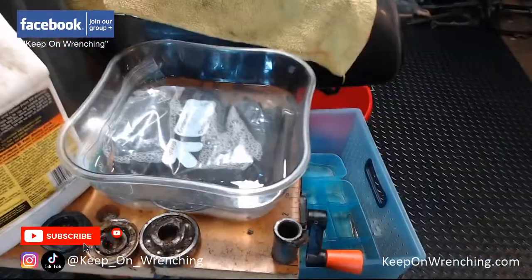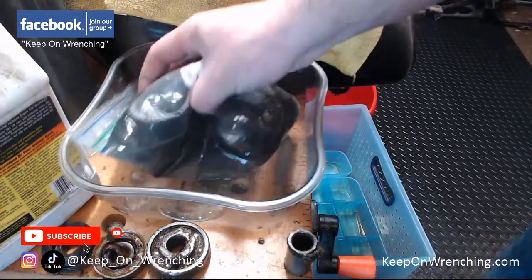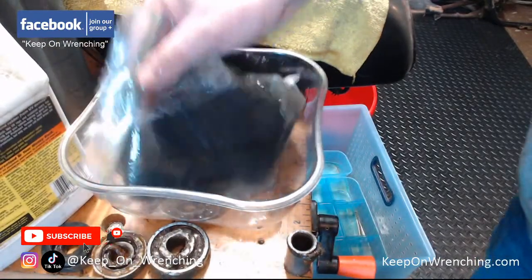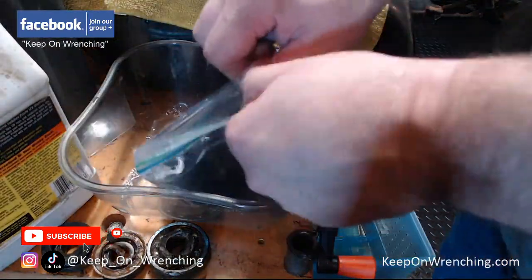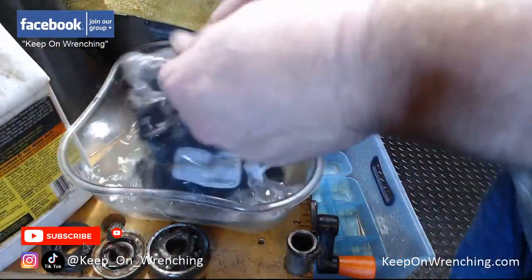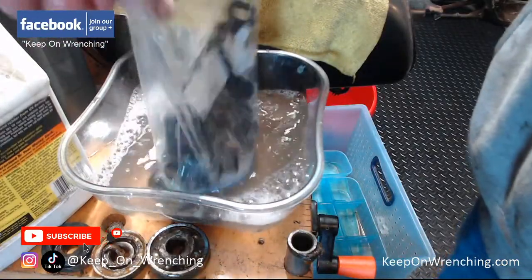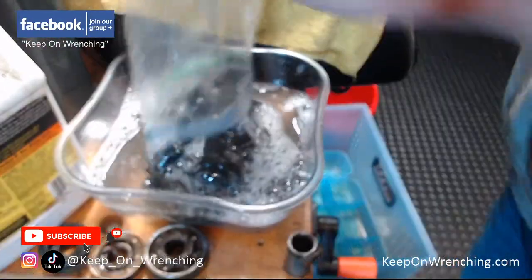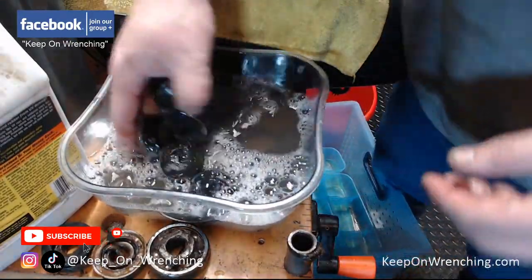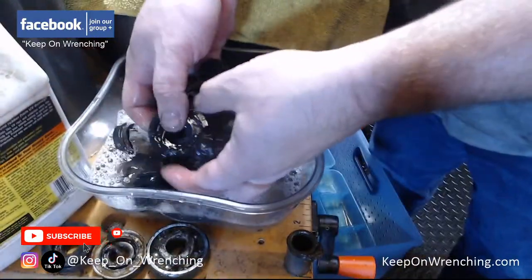When we're looking at all these parts, and we're trying to clean rubber parts, just get a Ziploc bag and put your Dawn and hot water in it. Throw it in a container and let it sit for a week and just agitate it every once in a while. So I left on a work trip, and I came back to these parts that were just sitting in Dawn. Now, these were filthy, filthy, filthy parts.